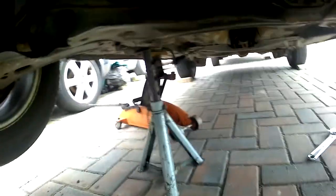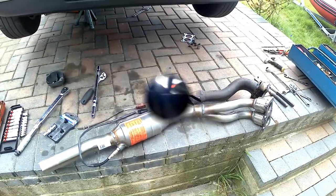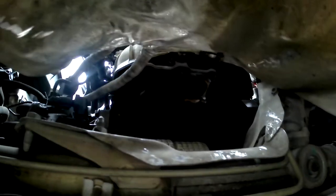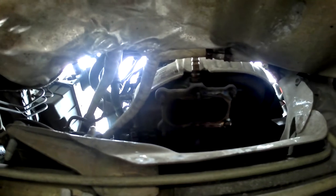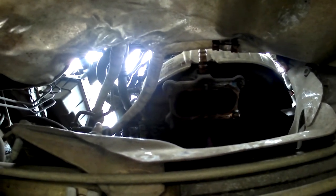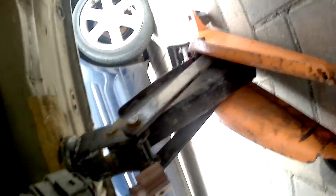You can probably see the plugs hanging there by the stand. It all fits under there and hopefully it'll be up and running. There's the exhaust here — we've got to feed it through this hole. There's an O2 sensor fitted just above it. That's the pre-cat sensor, and then you've got your after-cat. The after-cat will link up with this brown plug, and the black one is obviously the front one.